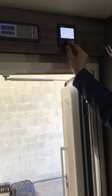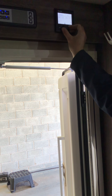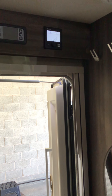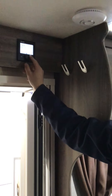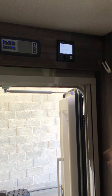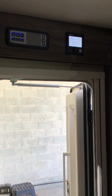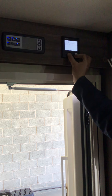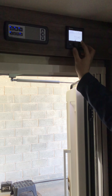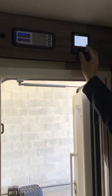We can come across as well — we normally find it gets too damn hot. We can set the clock and the right time, so if we are setting a timer with a start and finish, we need that clock to be correct. We then have settings where we can offset the temperature — whatever the temperature is showing on the main screen, we can offset that by five degrees, positive or negative. So if it's showing 20 degrees and it's actually 15, I could correct that manually. We can also change the temperature from centigrade to Fahrenheit, change the brightness of the screen, and change the clock from 12 hours to 24 hours.